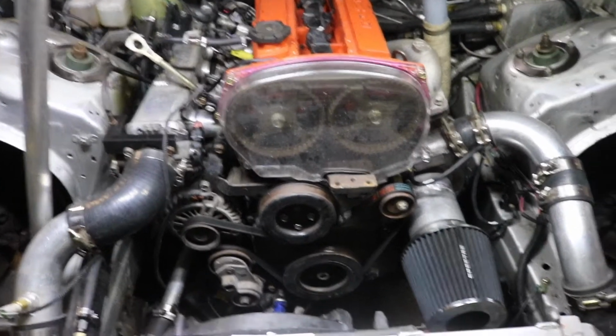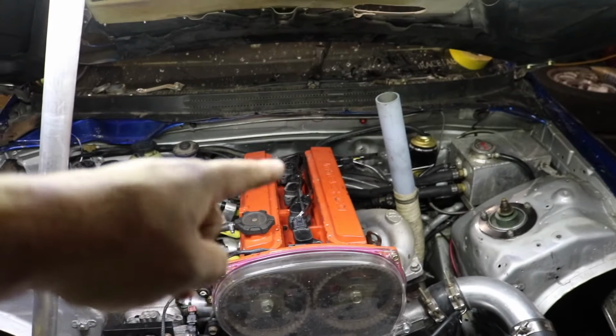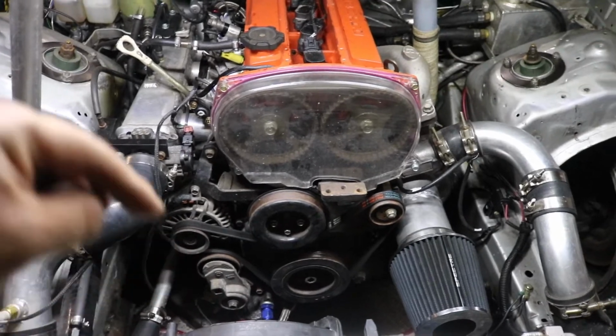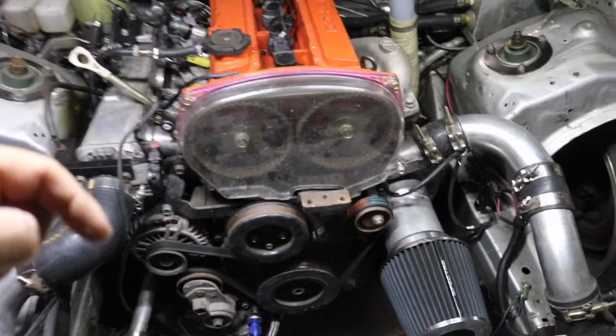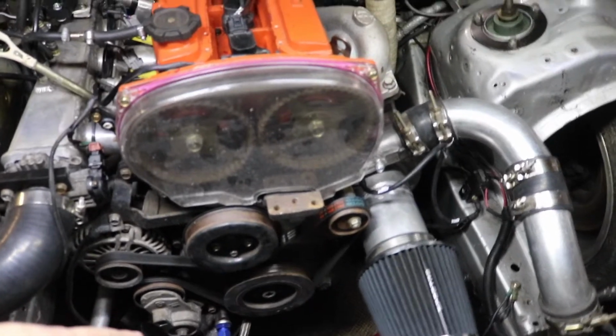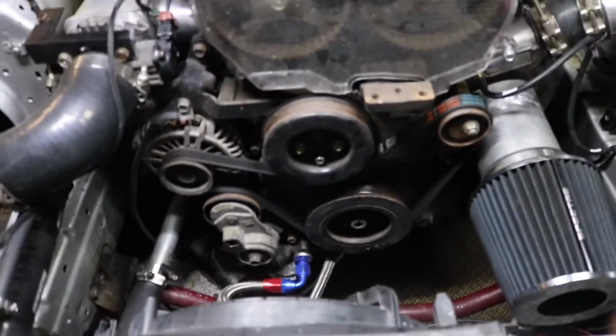The reason is he's getting a lot of weird readings with the cam sensor, so he wants to run it right off the crank. So I have to remove one tooth on it. By removing one tooth, he'll be able to tell where the engine is.